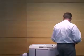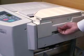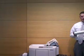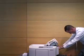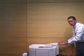The second consumable supply is the master. To access the master area, simply press the lever, lift and raise the cover, and remove your old master. Take your new roll and place it into the holders. Put it under the green finger and simply close the top. You've now replaced your master.